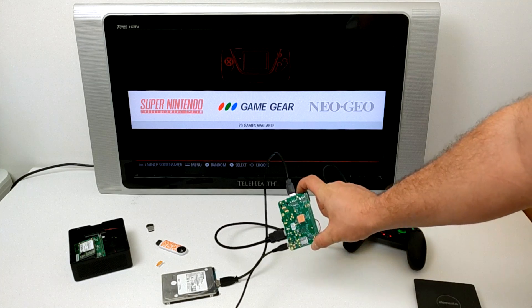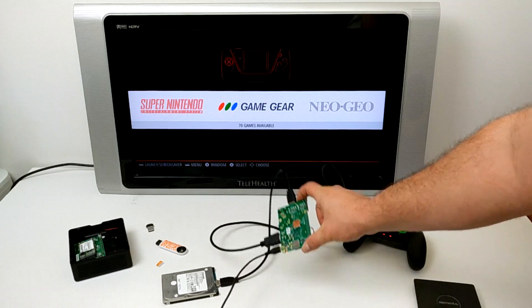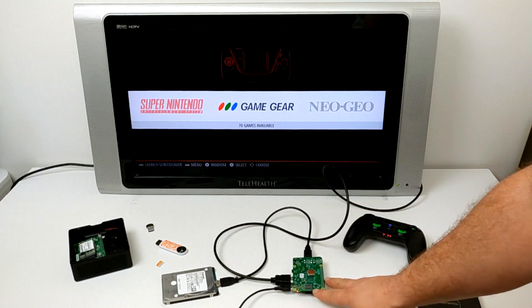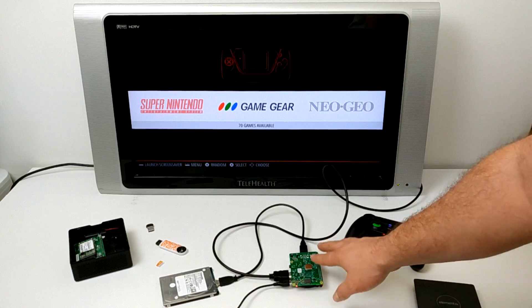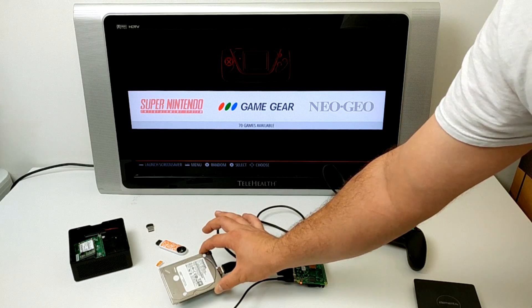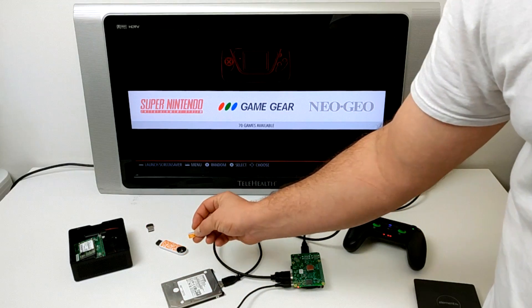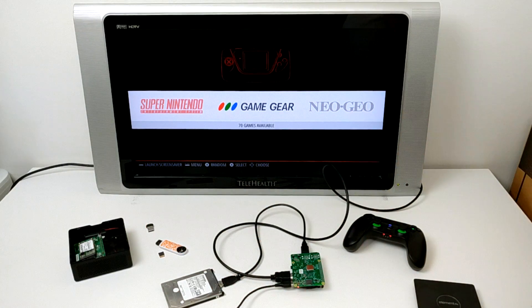The Raspberry Pi 3 will have to be programmed to boot from USB. I did make a video on this and I'm going to leave a link in the description — you can follow that tutorial to get up and running from USB. It does require booting from an SD card at first to program it, but after you set it all up you can flash to an external hard drive or a USB stick — anything really — and boot it from USB.